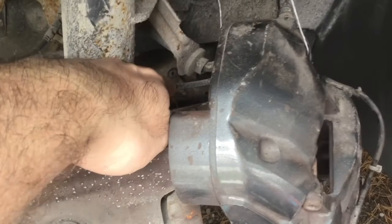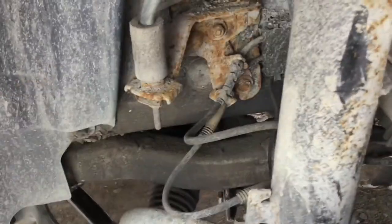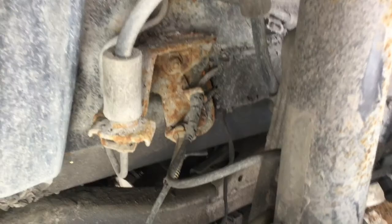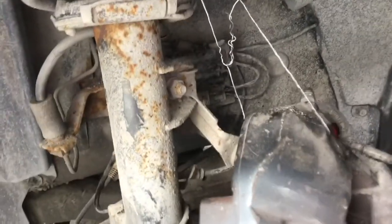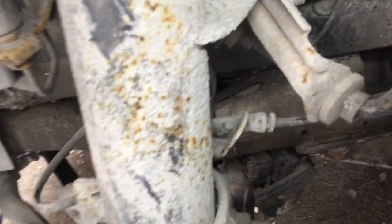On the driver's side we can see the brake pad wear sensor. You just follow that wire — it goes right here on the back, clipped here on the front strut, and goes all the way back up into a box. First off, I'm going to open that box, disconnect the sensor, and then unclip it all around. I don't like to cut it, in case the part I have is no good. This is the connector right there — the one that's clipped above the other one. It's pretty full of dust over there, but you can just scrub it with a screwdriver.